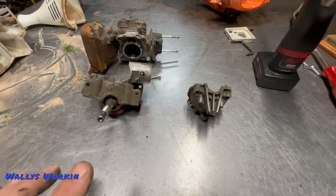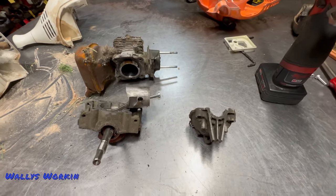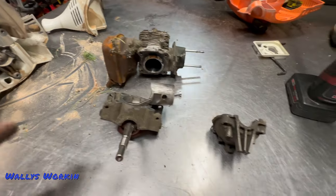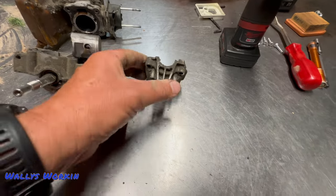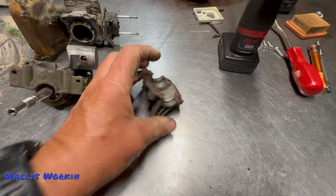Here's an old engine — this was the piston out of that engine — and you can see how it has a split crankcase design. The cylinder goes on top and the engine pan on the bottom. This engine pan here broke on the bottom where the bottom recoil mount bolts to. That's just from use — and it's not too often you'll see this on these units.